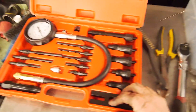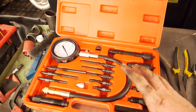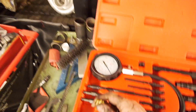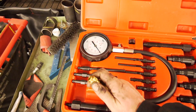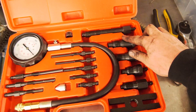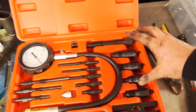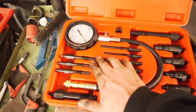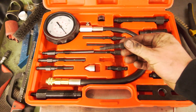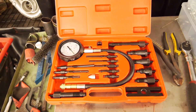Over on the bench here, this is my eBay compression tester — something around 50 bucks or so — and I can say it works really well. It's actually quite nice. It's got the quick connect/disconnect fitting and all different size adapters. So there's obviously injector-size adapters, or potentially bigger ones for some large engines, and also all your normal small glow plug sizes. For us, it's this fitting here. Essentially there's enough stuff to do all kinds of engines.